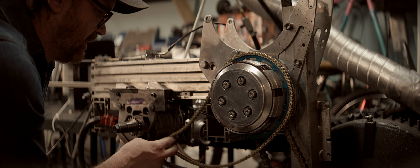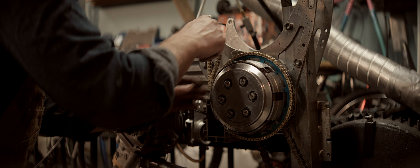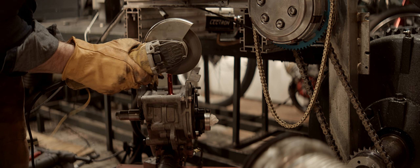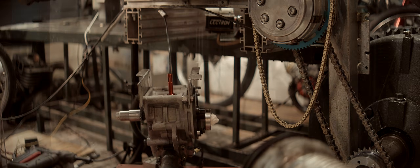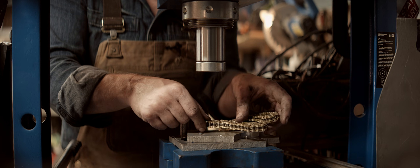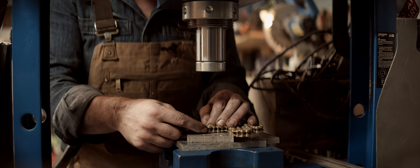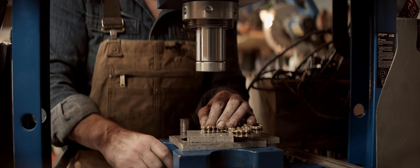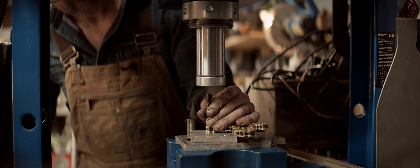We'll have to do some trickery here because we need to move the engine much much closer. I really should get one of those chain tools meant for this, but if I'm careful this should be good enough. The chain tools pretty much do the same thing as the press. I wish 219 chain links were more common.